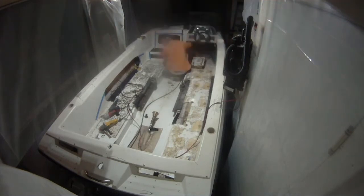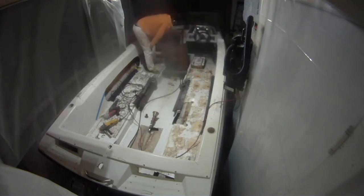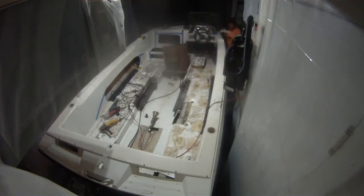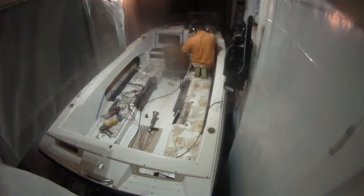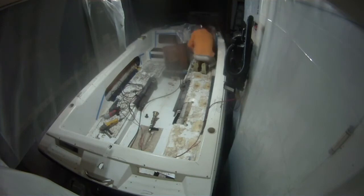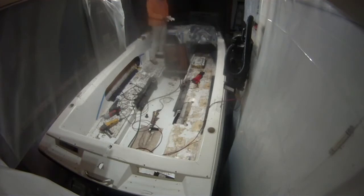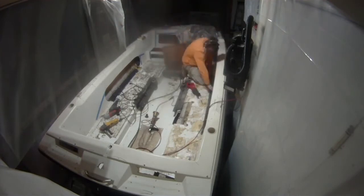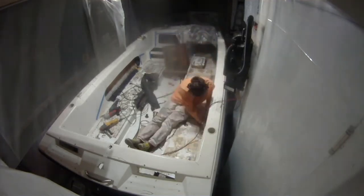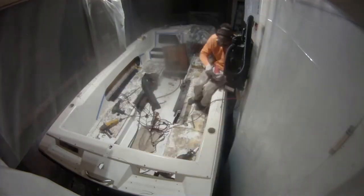Day 14 has had the most anxiety and pressure in the build up to it. Admittedly I skipped some steps here. Right now I'm getting the battery box out — it's a little panel that goes up under the passenger side seat. The steering cable is still running through it and I'm not totally sure how to get a steering cable off. I kind of buckled that battery box up and bent it out of the way so I could cut this floor up. There I am with a sawzall cutting into the floor. I went up under the gunnel cut right there — through there with the sawzall, just a deep cut. Eight-inch blade, wood blade. It just ripped right through, soft as butter really.